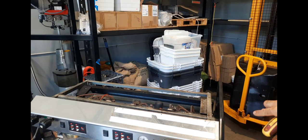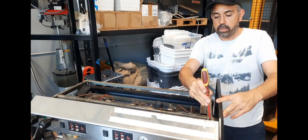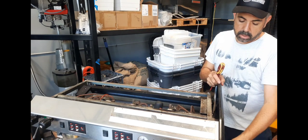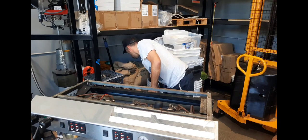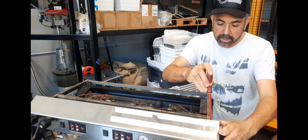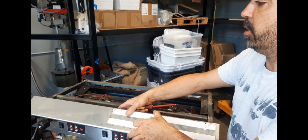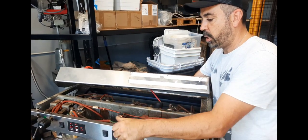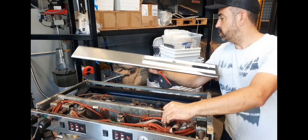The side panels are fixed here — this one's snapped off. With a small Allen key you've got to loosen a little bit, side screw off. Usually a flathead screwdriver in there, then that slides back and comes off. For the back panel and front panel, there's an Allen head here and here. Once they are off you can slide it forward and take that off. This gives you access to the touchpad panels, the switches, and also the top of the groups, which is handy for servicing.